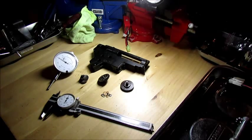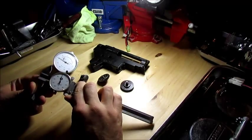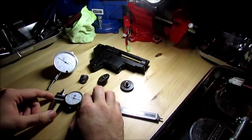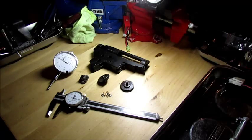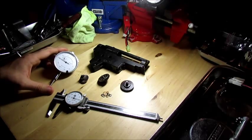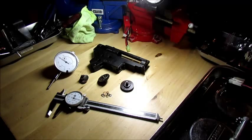You also need to make sure you get tools that aren't crap - high quality enough to actually measure properly. I picked these up at a swap meet; one may have been a Harbor Freight buy. The main notes from me: buy inches, buy mechanical dial - do not get electronic. I don't like a computer trying to decide how far something is apart. Also, keep the parts clean because these calipers can measure dirt that gets between the pinchers.